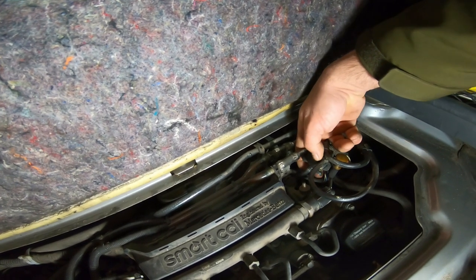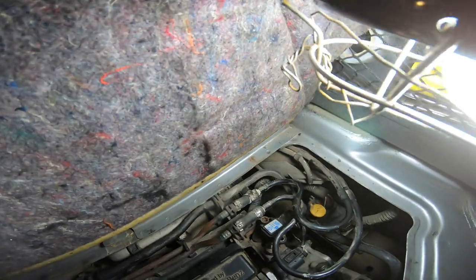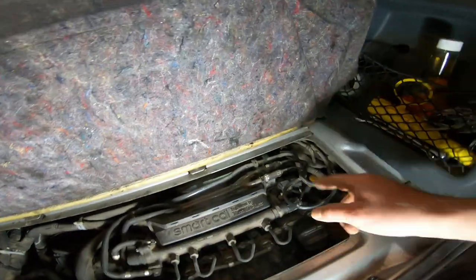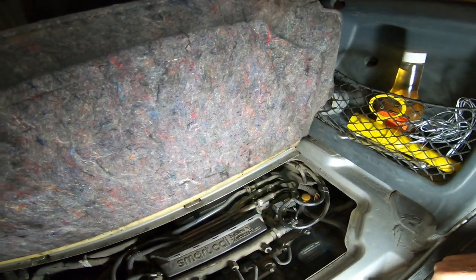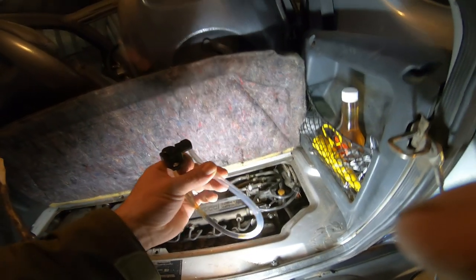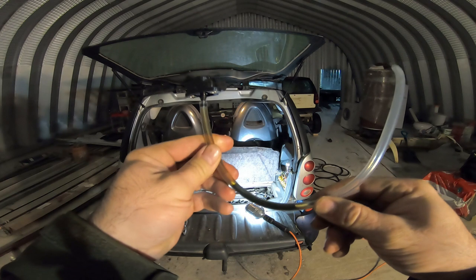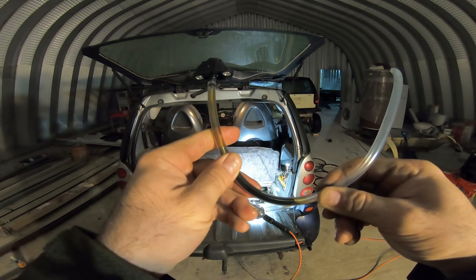There's just that hose there that goes into the sensor, and that's the only sensor on the intake. So if your car is misfiring at mid-range or stuttering, that could be it — a little bit of oil got in the pressure hose and it's not reading the pressure accurately. As an example of what's going on, I've got a clear hose with some oil in it. The MAP sensor sits up high and the hose goes down low on the intake — kind of a stupid design. Why couldn't they put the hose on top of the manifold instead of the bottom where it collects oil?